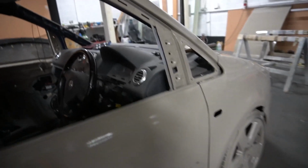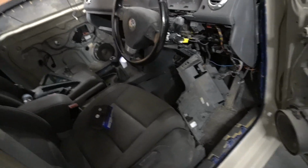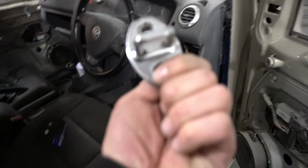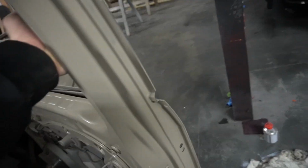It's really easy. These are actually really easy doors to hang as well. What you want to do is just get your latch on, tighten it so it's snug, close the door, open it, and it should stay roughly in position, and then just tighten it, check it, tighten, check it, tighten. I'll just set the tripod back up and film the process.